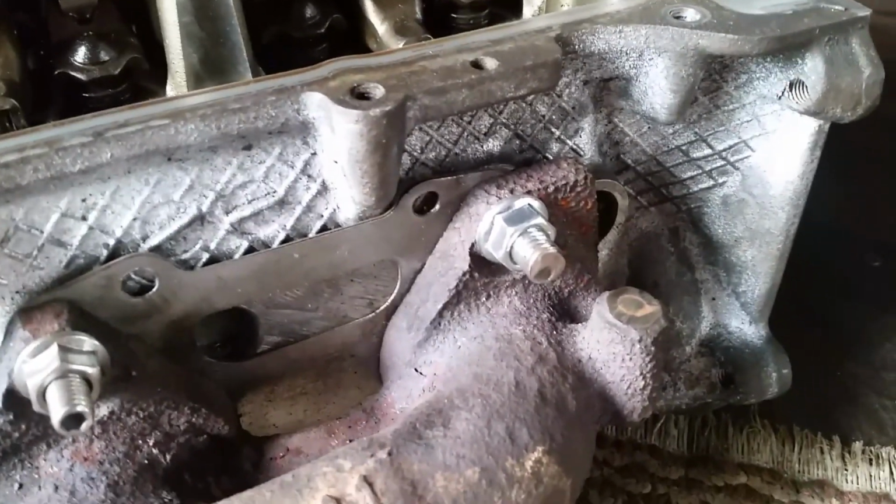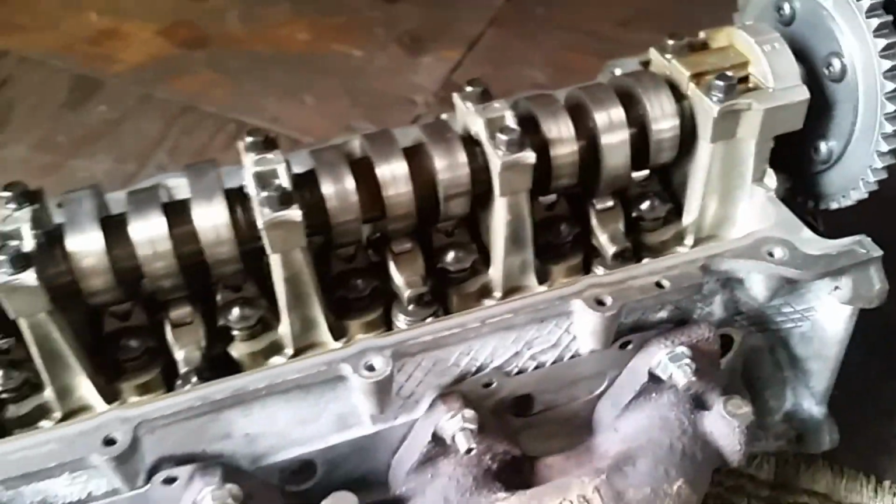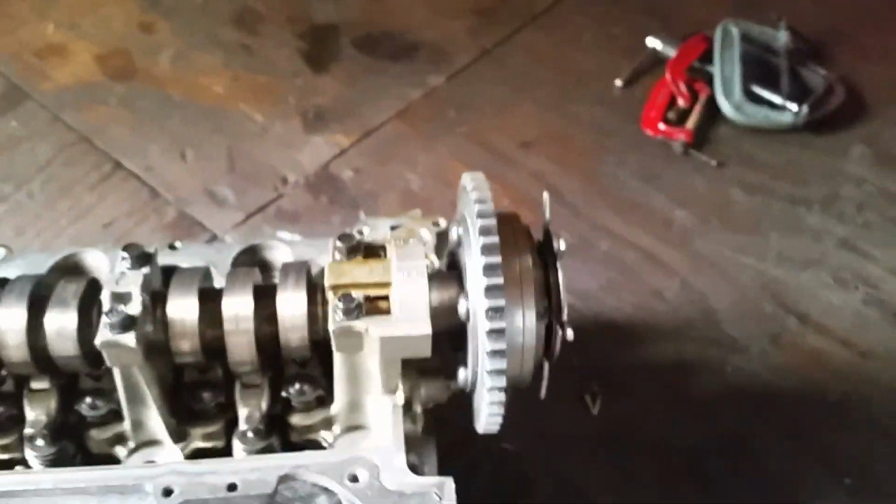And this one here, when I drilled out, I had to actually go size up a little bit more because that head was in there pretty far, and that bit did all it could to get it out, and I had to re-tap the threads. So other than that, everything else here is in pretty good shape. That's pretty clean. I might have to clean it up just a little bit more before we stick it on there. And the good thing is I didn't have to take off the cam phaser gears. So I am good there.